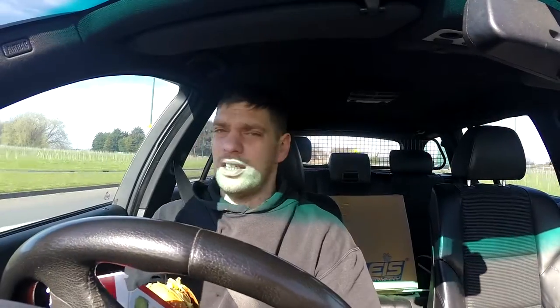We should have the cooling side done. I've got a medical at one o'clock, but that's only round the corner where I work. So hopefully get the medical done, come back and then start wiring the electric fan in. I'll fit the fan to the radiator before the radiator goes in — might as well, saves fiddling about. And then I've got to wire the relays up and figure out which wire to take it to — the thermal switch on the side of the radiator.